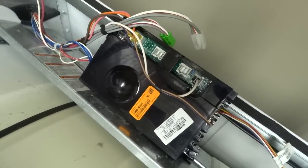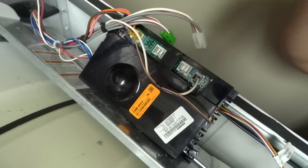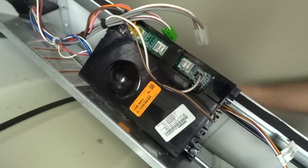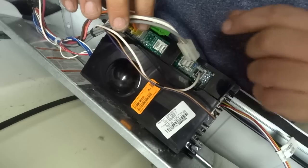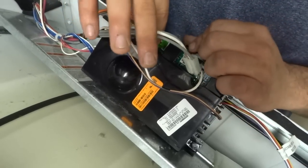What you'd find is if it's shorted, it's always sending power. Sometimes they'll break while they're operating under load, but generally if they're open like this, you're probably safe. So you can go ahead and put this back together. That's an E61. If you find that they're shorted, you need to replace the board. The relays have broken.